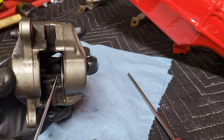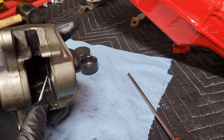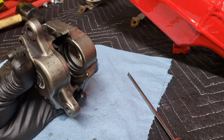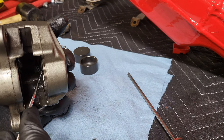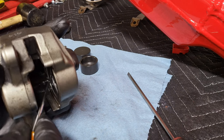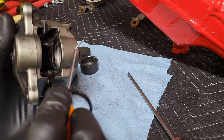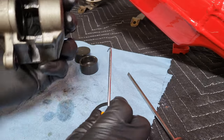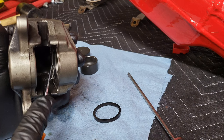Be very careful with the pick tool. You don't want to reach in there and start picking and prying with a lot of force, because if you slip and scratch or mar up the inside walls, you're not going to have a good seal — you'll have leaks and need to buy a new caliper. Definitely take your time. Not a lot of force is needed. Get a narrow pick, push the seal over to one side, drop your pick tool behind it, and it pulls right out. The bigger seal is a little easier because there's more room in that channel.